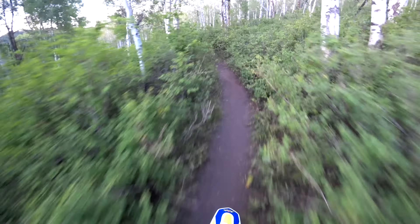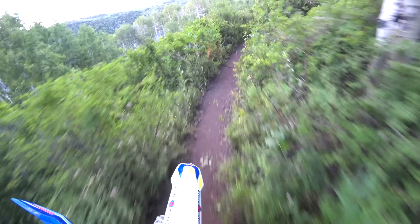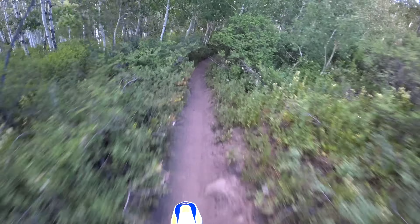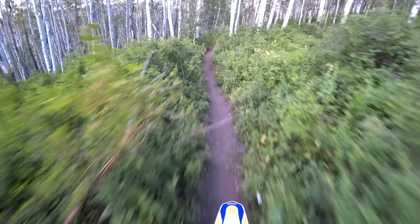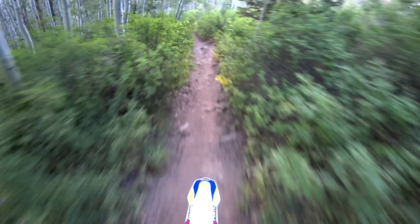I think that's what Rich Larson did with his 2020 Sherco for hard enduro — running the stock KYB with just loosened clickers. As far as changes to the shock, I took three clicks of compression out — low-speed compression — so I opened it up three clicks on the low speed. It seems to be doing well; I might speed up my rebound just a touch as it's got a little bit of a dead feeling, but that's the thing — these Shercos have their own feeling to them.